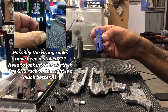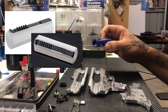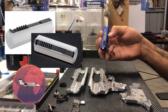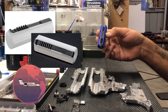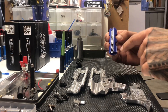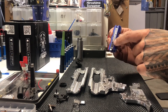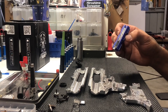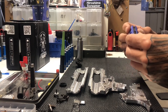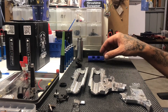What I've actually ordered is some purpose-built DSG pistons. They are coming from France though, so I'm guessing there's going to be a bit of a lead time. But they're specifically designed for DSGs and they're actually radiused in these corners. They come with either eight or nine teeth to suit whatever DSG you're running. I've ordered the nine tooth, even though I'm running eight teeth sectors — I'll just grind out that last tooth off. So they should be here hopefully in a couple of weeks.